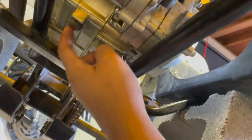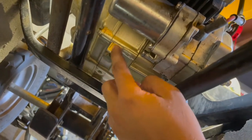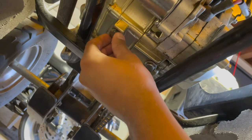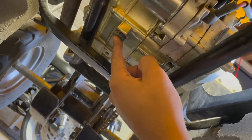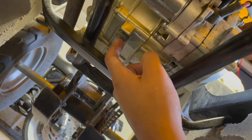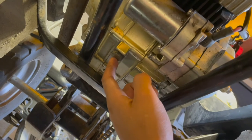When you're under here, this is actually the bolt you want to undo — there's a little tab in front of it, it's hard to miss. It's a 17 millimeter bolt head, so just use a 17 millimeter socket. After you empty all the oil out, make sure you put that bolt back on, because when you try to fill it up with oil, if you don't, obviously all the oil is going to pour out the bottom. It's hard to mess it up.